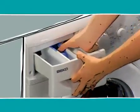If you always seem to have soap powder or fabric conditioner left in the drawer after the washing cycle's finished, check that the drawer's not become clogged. You can unhook the drawer like this, and then have a look inside and rinse it out if it's got gunk inside.